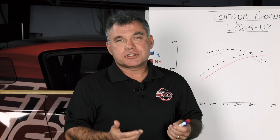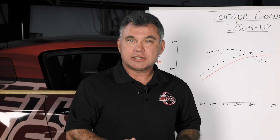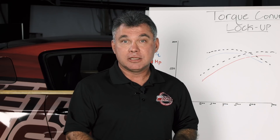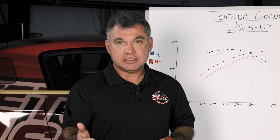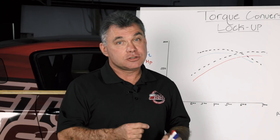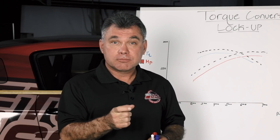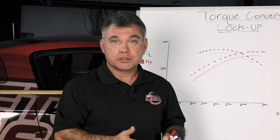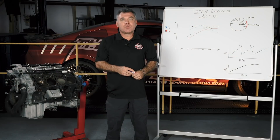The difference between a roots and centrifugal is that a centrifugal has to be turned by the engine to make rpm — you don't have that instant torque at 2800 rpm. You're going to get that torque around 4800 to 5000 rpm. So you need a torque converter that's going to get you in the power band immediately, but at the same time you can lock it up at the top to keep you in the power band and maintain efficiency for your mile per hour and best ET. With a centrifugal supercharger the lockup point will be up in the higher rpms. With a roots style you can move it lower because you have the excess torque. With a turbo, once you've found your peak torque, just lock it and roll.